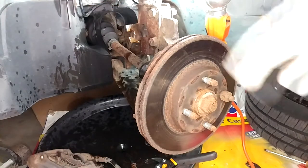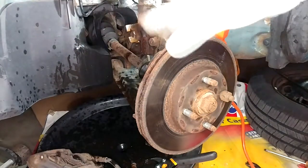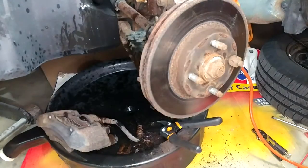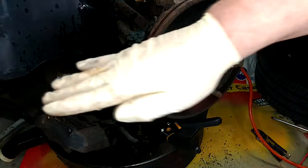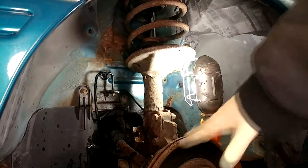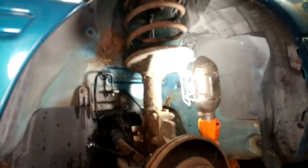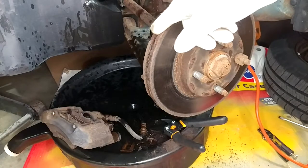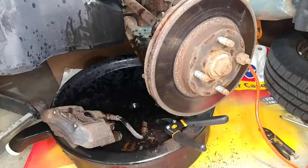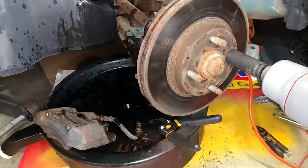You'll notice there are some non-sequiturs here, meaning some work has already been done. Basically I've just taken the brake caliper off because I'm replacing mine. If you were planning to keep yours, get a bucket to put it on — a five gallon bucket upside down scoots in here almost perfectly. You're not going to want to wire it up to the strut because this is all going to be flopping around. To get the caliper off, there are two 14 millimeter head pins that just come out and off she goes. Our next step is to remove the disc.